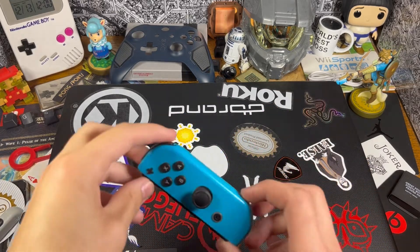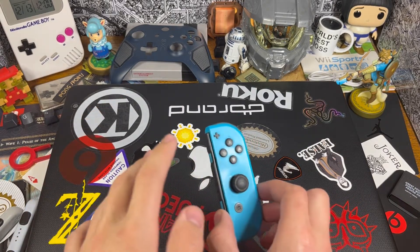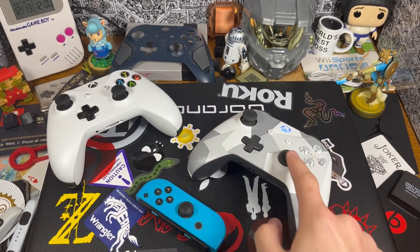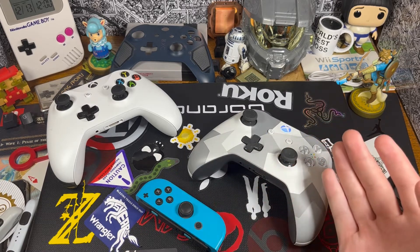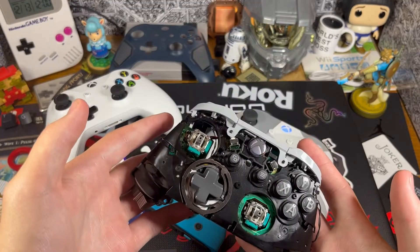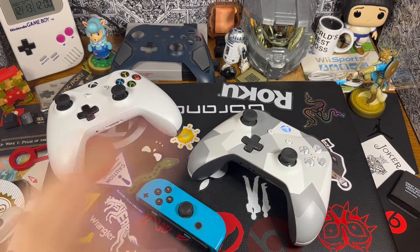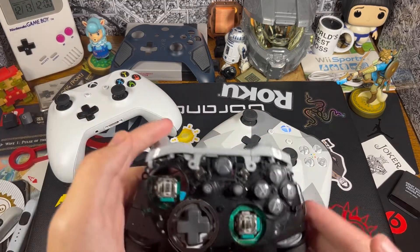Joystick drift — even though the Nintendo Switch gets a bad rep for it, commonly termed Joy-Con drift, it can happen to any analog sticks that have potentiometers that wear out over time. This means your Xbox controller, your PlayStation controller, whatever it may be — if they have potentiometers in the sticks rather than the newer hall effect sensors, they are susceptible to damage over time. Every single controller will eventually get drift, but you can actually fix drift for completely free. It takes a bit of time and effort, but for zero dollars, assuming you have a screwdriver and the free time, you can fix drift on your controller.